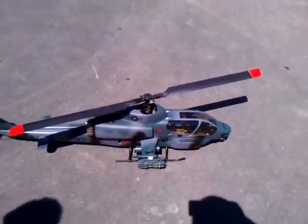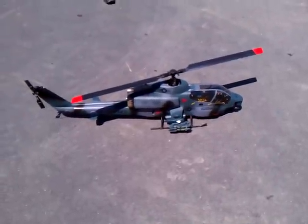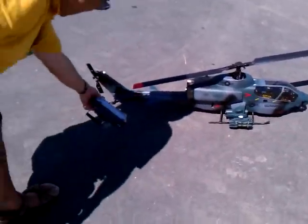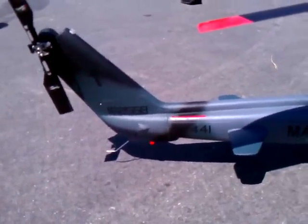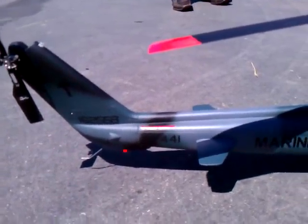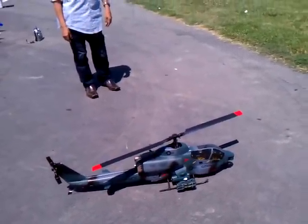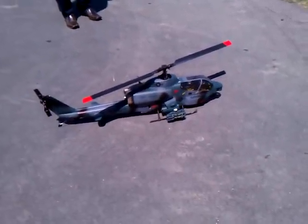This is the Align Cobra with a T-Rex 500 in there, and it seems to be a winner. The build quality is really nice. If you do build this, check the tail gearbox - make sure that your gears don't bind against the inside of the gearbox. I blew my first set of gears and found out I had to dremel out the gearbox holder itself to clear the teeth of the gears, because it just stripped the teeth off. Great heli. Thanks for watching - DennisRC.com.